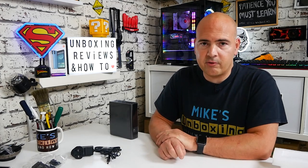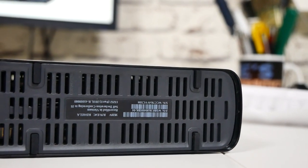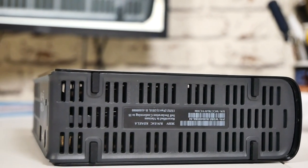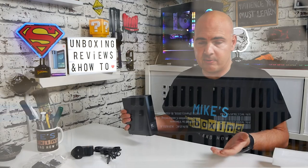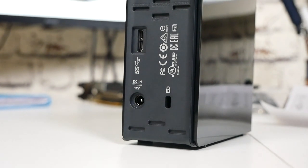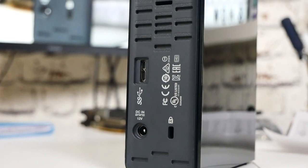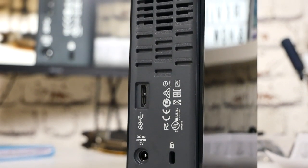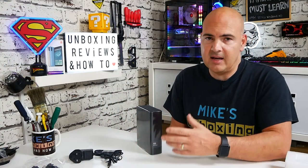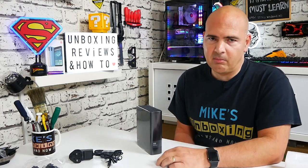The drive inside is 5400 RPM — a relatively low rotation speed, so it doesn't cause vibration issues. On the bottom there are nice rubber feet which absorb vibrations anyway. The unit itself isn't particularly heavy. On the back you've got a Kensington lock slot, a 12V DC power input, and the USB connection slot. There's no power on/off switch — when you turn your PC on with USB connected it wakes the drive up automatically, and it will put itself to sleep, which is where some problems may arise if you're planning on shucking.